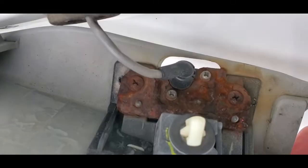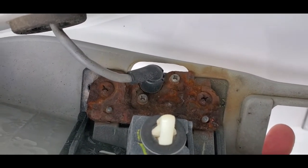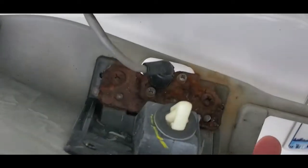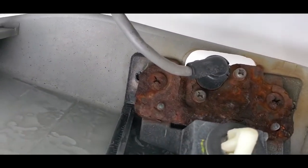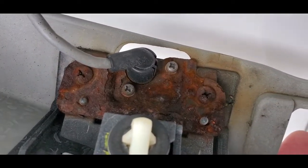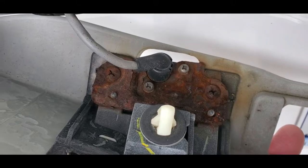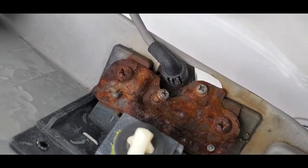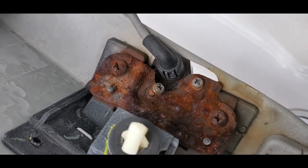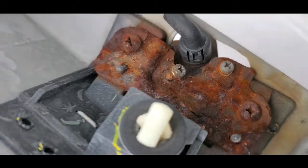There's the camera. Ooh, so water and all kinds of crap just pours through this seam up here, so it doesn't surprise me that it looks like that. So I'm going to take those 2 larger Phillips head screws off of there, and I'm going to remove the camera and see if I can't find out what's going on. So after some attempts there, those rusted screws aren't moving. So these 2 silver screws, though, are the ones that actually remove the camera.